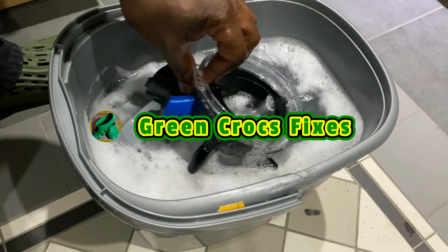While that's washing, I'll just show you the motor head — that's also blocked with dust. So first thing we're going to do is remove the brush. You can use a coin to undo the brush head — just undo this cover here and the whole thing should slide out. It's a bit stiff because of all the string and hair around it. I'm going to use a pair of sharp scissors to cut the string and hair off the brush roller.